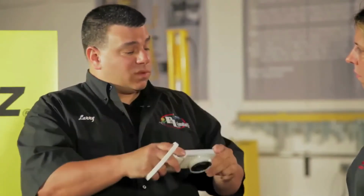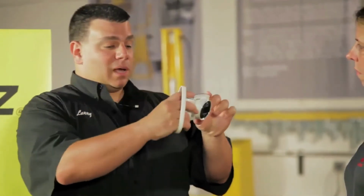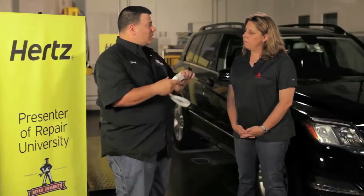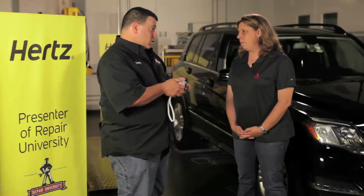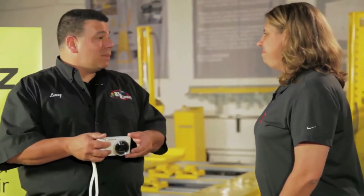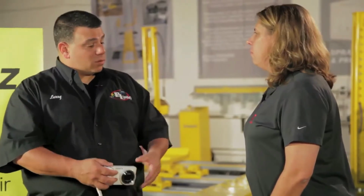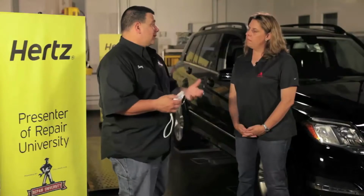The big issue that I see a lot of people make is they'll take a picture of the bumper cover, which is down low here, and they'll take it from this position with the camera angled mostly like this. It's on an angle, so it's going down. You're not getting a full view of it. The best thing to do is to either bend down like into a catcher's position or hold the camera low. Obviously, some older people or some people who have bad knees may not be able to do that. You can still see through the viewfinder in the back. You can still take the photo. You want to have the camera looking level like your eyes would so you can tell the story.